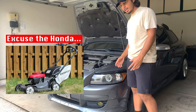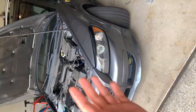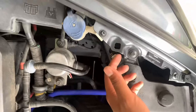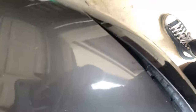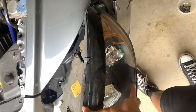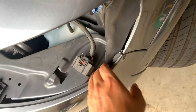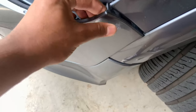Once you remove those T25s from the liner, we're gonna go ahead and take out the headlights, which is insanely easy. This is seriously insane — I love Volvo for doing this. All you have to do to take the headlight out is find this metal retainer, pull that out, and then you just push. The entire headlight comes out just like that. Now that the headlights are out, go ahead and find this corner piece and just pull that out a bit — get that loose just like that. And the other side.